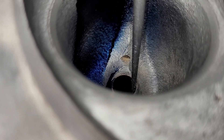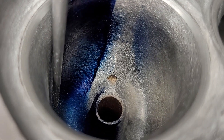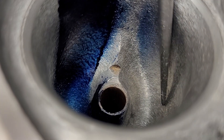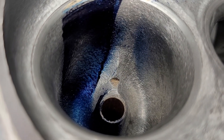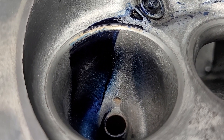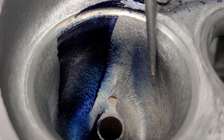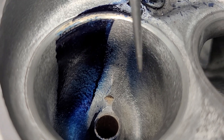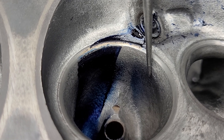Because of the way the casting was made, I had to put more of the port in order to get the bowl the same width. That's going to change our port bias, and that's going to do a couple things. One thing it's going to do is totally mess with our swirl, because now you've got a lot more air coming out on this side than this side — so that's going to give us less swirl most likely.